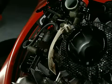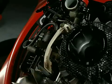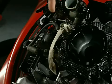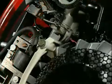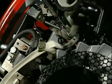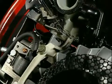The air vane governor system is an uncomplicated mechanism primarily consisting of an air vane, a link to the carburetor throttle shaft, a governor spring, flywheel fan, and blower housing. The air vane is free to move around a pivot point anchored to the engine. The link extends from the vane directly to the throttle shaft, where it's joined by one end of the spring.